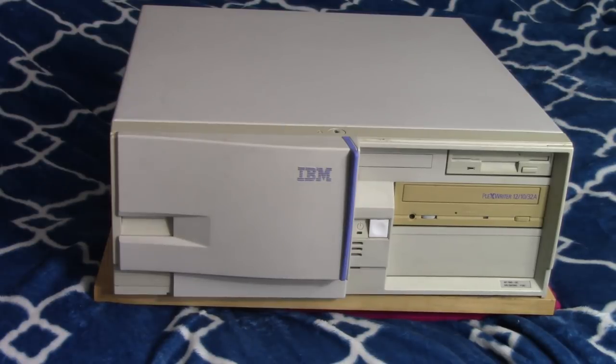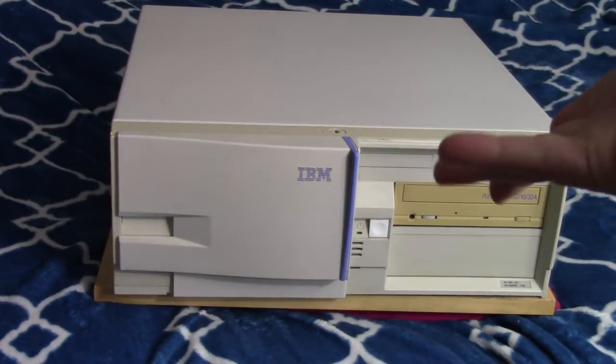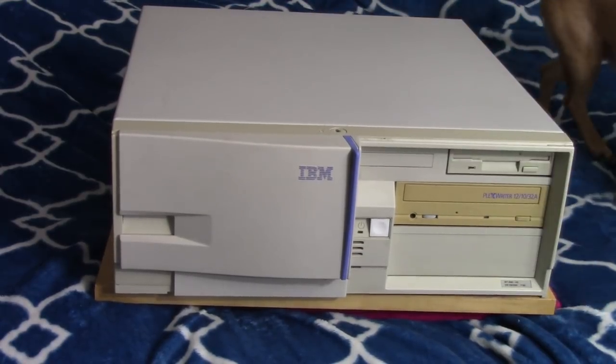As for that Cyrix CPU, specifically I'm talking about the PR166+. Now, I didn't do a ton of benchmarks, as you saw. I played some games and did a couple of benchmarks, and it's where you expect it to be. It's a little bit in front of the Pentium 133 in most cases, but we're talking just a couple of frames. And with the incompatibilities it seems to create, your machine may work fine with Windows, but obviously in my case, it created a weird issue where I couldn't get Windows running, and Windows wasn't the only thing. There were a couple other programs too that had some issues.